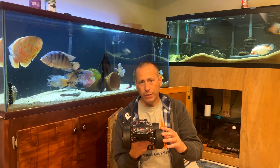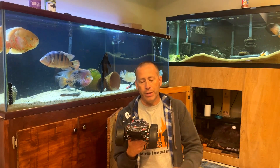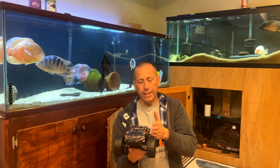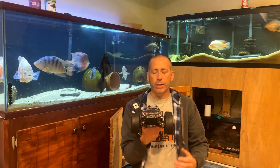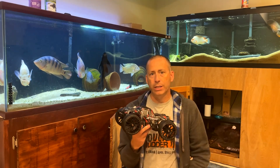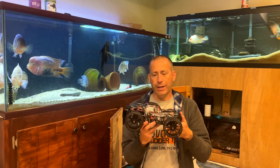Part of the reason is I had removed those 15 millimeter hex extenders, but the other part is these tires — they're set in further than the stock tires, which made the track even narrower than it would be stock. So way too tipsy, and I was worried these 15 millimeter Sharego hex extenders would not be enough for this setup.